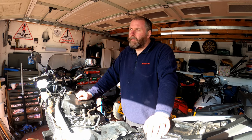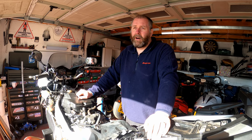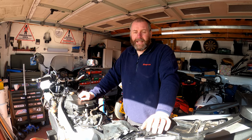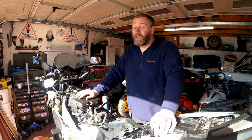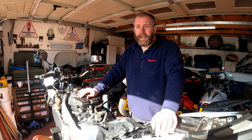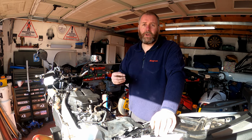To that end, because of the costs involved, what I do find a lot is people say I've not bothered having it done, my bike's fine. Now what I will say is that this is a valve clearance check - you're not guaranteed to need to do an adjustment. It's literally checking to see if they are within spec. If they aren't within spec then there is additional work required and additional expense, particularly with the VTEC buckets because the VTEC ones have to be replaced entirely.